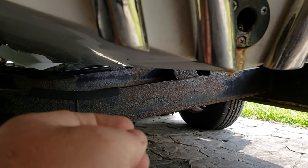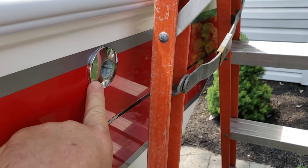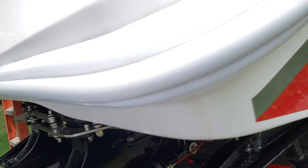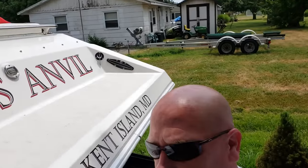It's what they call static pressure — any water that comes off here and goes up works off static pressure. There is no pump that runs these; it's just water pressure that comes in and cools the intercoolers. The reason they do it that way is so you don't get condensation between the intake and the intercooler when the motor is running at lower temperatures. This is the static blow-off for the intercooler cooling system and it runs both of them. Let's go up and take a look at the header, the port motor, and why it's not doing what it's supposed to do.